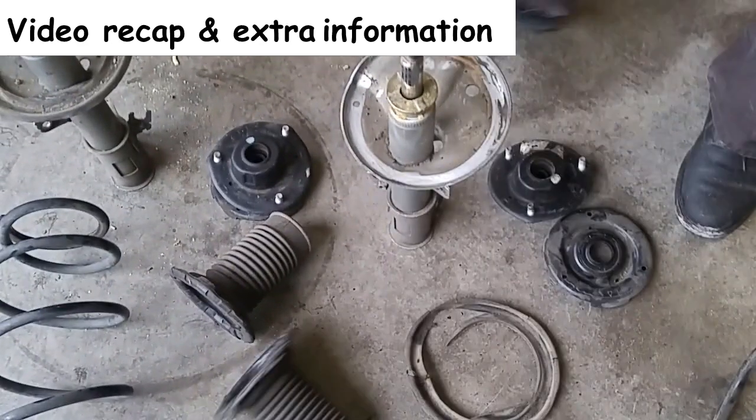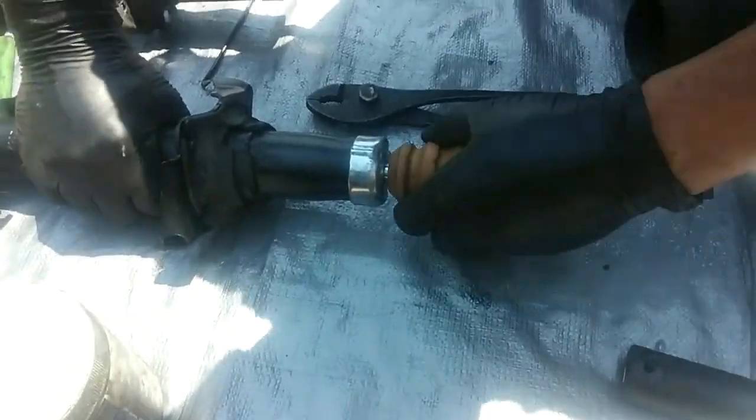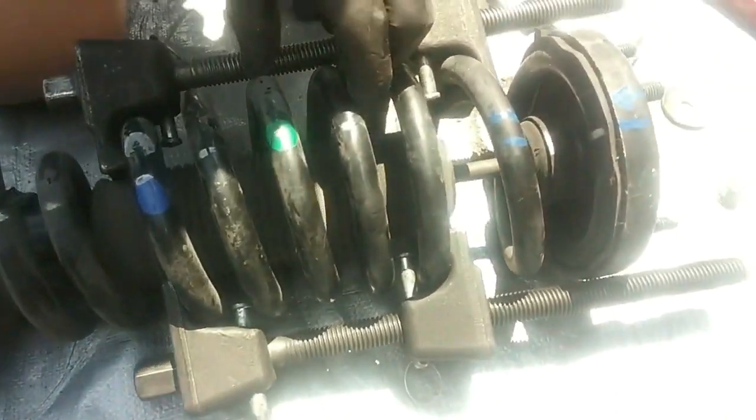Before replacing the suspension strut, check for wear of other components that make up the strut assembly. If these parts aren't replaced, the new strut may sag, make noise, or prematurely wear out. The struts being dissected came off the front end of a Toyota Camry. It's different from the rear struts in that it rotates with the wheel. The upper strut mount assembly acts like a ball joint, with a bearing sandwiched between the spring seat and strut mount. Front suspensions with upper and lower control arms, like on Hondas, do not have these types of rotating struts — they are fixed like the rear end struts on a Camry.